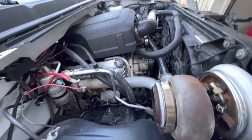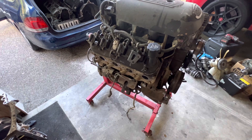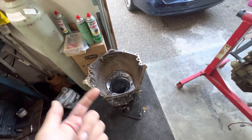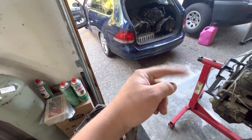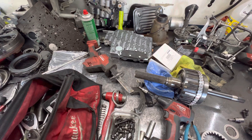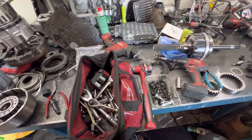As a quick update, this thing's running great. I got a customer project right here — a GTR. Doing a transmission on that thing, paying bills, paying for all this fun I'm having here. The truck is getting a 4L80 upgrade. I had a torched 4L80 that I had taken out — it's now gone. I traded it for this good 4L80 from Pick and Pull, and this is actually the 4L80 that was attached to this engine, so these two were together at one point. I got it all tore apart. Right here on the bench I spent about $400 on a recalibration kit and a trick kit from Jake's Performance. It comes with a heavy-duty forward hub, the HD snap ring, and a couple other little mods. Got the accumulator block off — a couple good parts inside that are going to increase the strength of this unit.